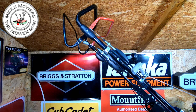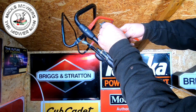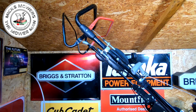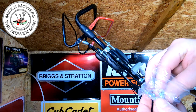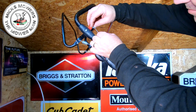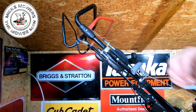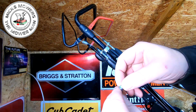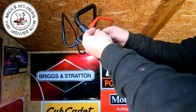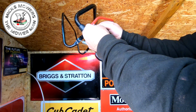Okay, so I've got my cable connecting tools. Let's just cut that bit of cable off of there. So the first thing we want to do, nice and tight as we can get it. That's that gone. And then I've got these Z bends, which should go on. So that will fit into there. No drama. Well, that might just go. I might just literally have to extend this cable slightly. So all you do is undo these little tiny nuts on here, undo those, slide that in so it fits, and you want to turn it round so it's going around the right way.